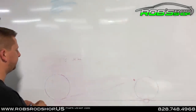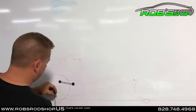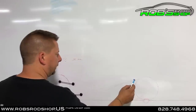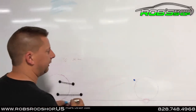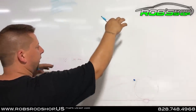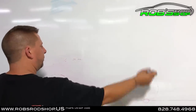If you'll pay real close attention, we're going to use this as our upper control arm, and then we're going to use this as our lower control arm. As you can see right here, we have our rear wheel, we have our front wheel, we have the ground in which it rides on. This point right here — I use this diagram a lot during the day, so there's a bunch of lines already up here — but this is our center of gravity mark. This is where, if we hung the car by a string, the car would balance. This is where the center of the whole mass of weight is.